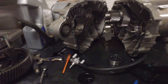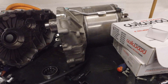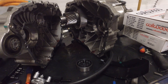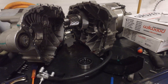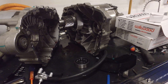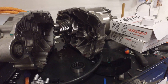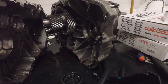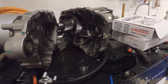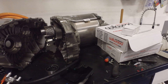The limited slip differential should hopefully arrive soon. Once it does I can drill the necessary holes in the case — just got the pump this weekend. I'll need to sort out fittings and drill through the side of the case; not a fan of that, but it seems like the only way. Some people run these units upside down without any special lubrication modifications, and it probably works for a while since this is pretty thin fluid that gets splashed around. But these motors can be pricey and I don't want to damage it — plus it's a useful experiment for anyone else attempting this swap who runs into the same issue.